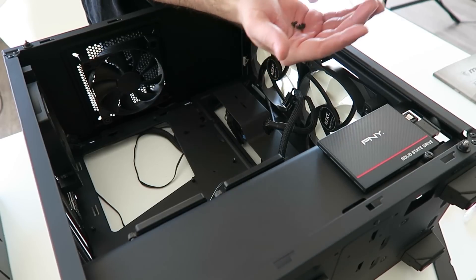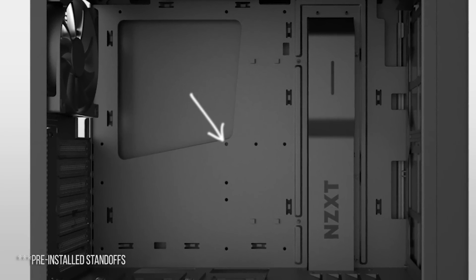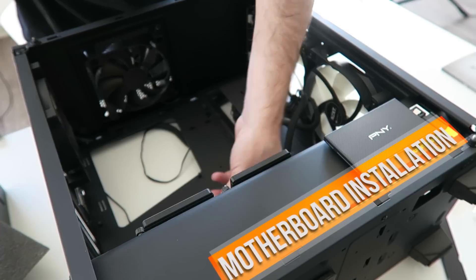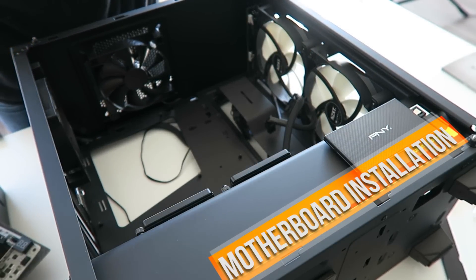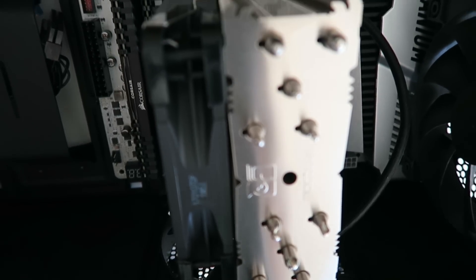Now let's put the motherboard in the case — we're rocking the NZXT S340 Elite. There are nine mounting holes within the NZXT case; one of them is actually a raised standoff, so you don't need a screw for that. It goes in the center mounting hole and helps secure the board during installation. What's great about upgrading is you don't always have to start completely over — I've left my power supply, storage drives, SATA data and power cables already in. Move all SATA cables and front panel cables out of the way so the motherboard doesn't go on top of them. Visually make sure there are no stray standoffs that could damage or short your motherboard.